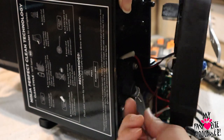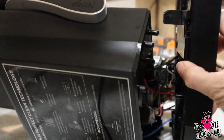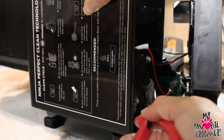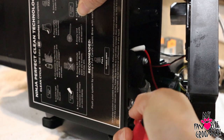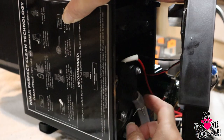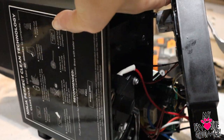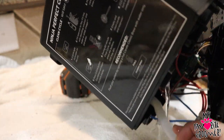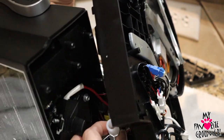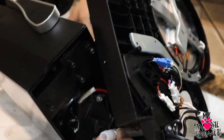So you can access this pump, this hose, this hose. Take your needle nose and move it around. Take it off of the tube so it's just on the plastic hose. Pull this tube off — water's going to come out, which is why I have a paper towel here. You're going to take this hose and push in that water spout we talked about earlier. Push that in and blow through the hose to blow anything out of it.